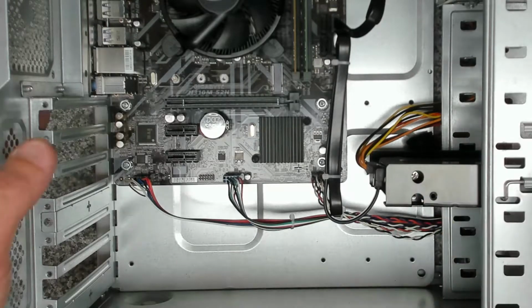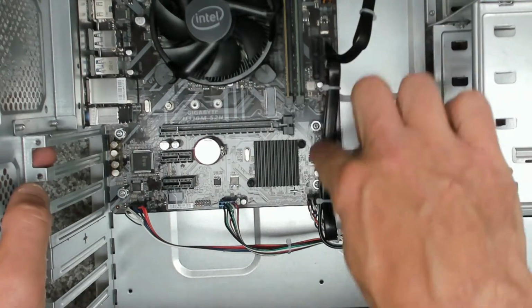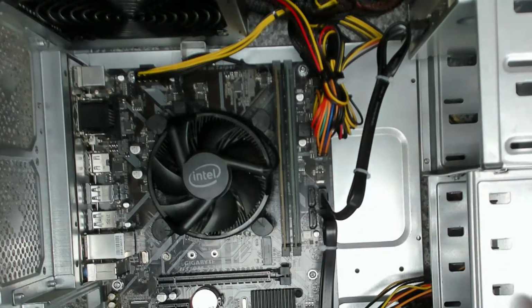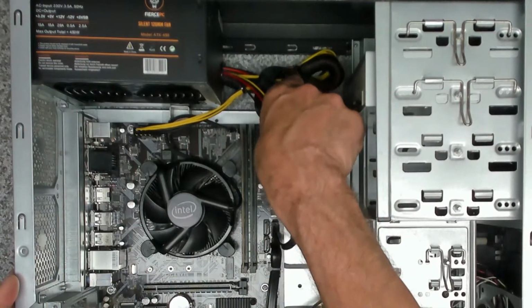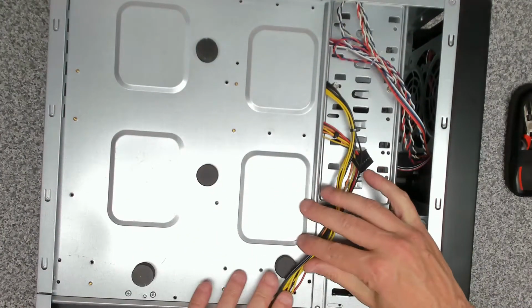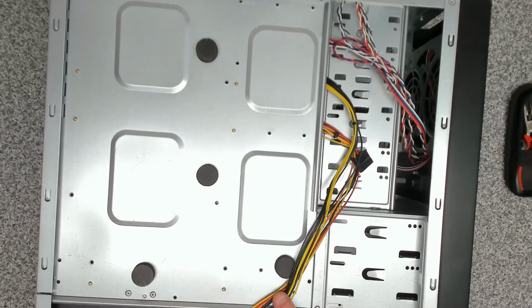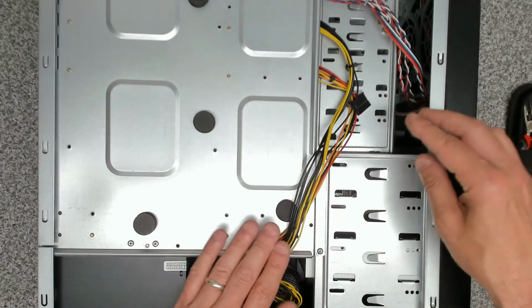We've got our SSD drive mounted in the drive cage. Cables are running around the back, and we've got our SATA cable to port 0, and then our DVD writer into SATA port 3. And then all we've done is just hide up or crunch up as many of the cables as we can just to sit in that space, so it's still nice and empty. And then on the back, we're just going to trail these over. The case cover should go on as long as we have these flat against here. It shouldn't rub because we've got these standoffs here, so we should be okay in terms of that.